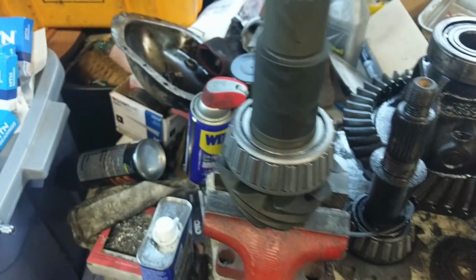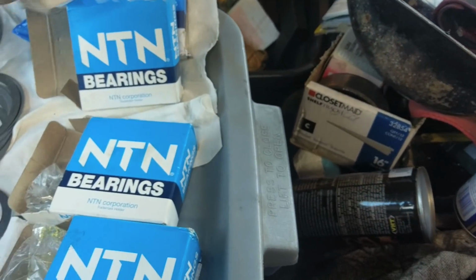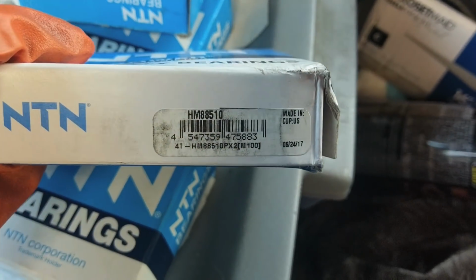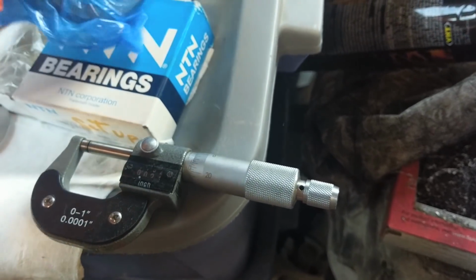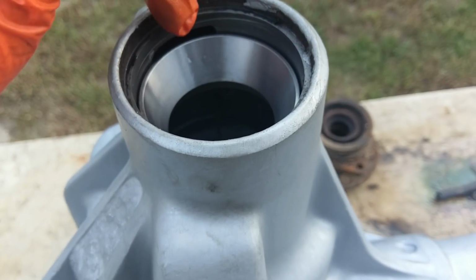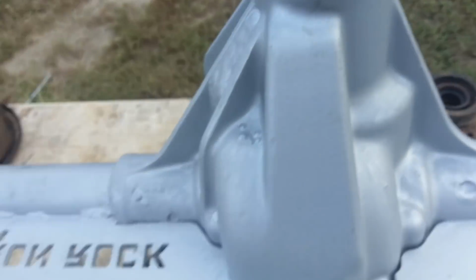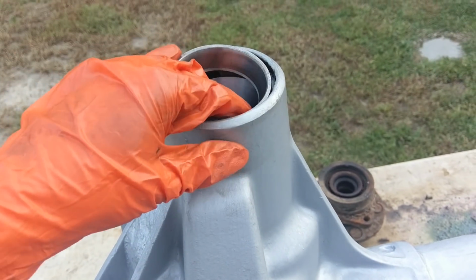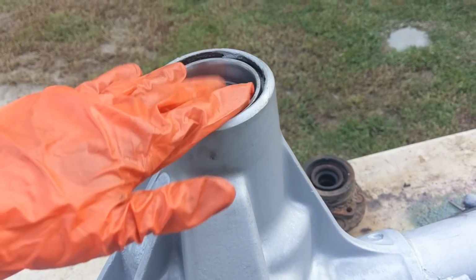So that's good. Next, they say that you should put the rear pinion race in. So that is this guy right here. This one. Okay, so pop him out and install him the same way that we did the other one. Next step is to put in the tail race, like so, so the cone sticks out. Easy trick. Again, take this guy, pop it in there, and it's actually real loose up at the top. So it just fits in there.